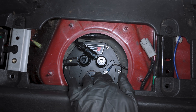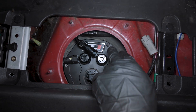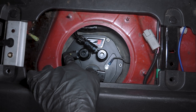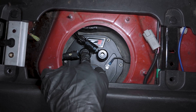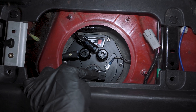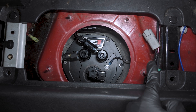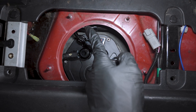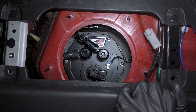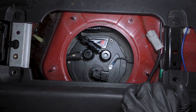Once you reinstall your top hat — in the case of this exact car we used a Z1 top hat — the OEM line is going to connect just like normal and that becomes a return. Then that 180 and the hose we supply will come up roughly around here, curl around the back, and come into this line here. It looks a little different because of the configuration but will look more simple on an OEM setup.